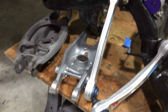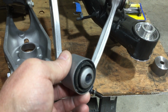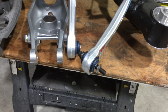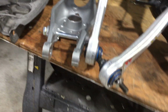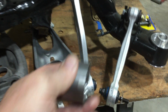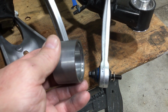And then normally it has a rubber bushing, and I press the bearings in there, and so it has a taper on one side to go to the knuckle. So I had these washers machined up, and now this bearing has to be offset 3 millimeters to work correctly. So I machined up this cup for the press, and if you'll notice here, it's offset 3 millimeters. So now I take this cup, put it in the press, and I press it, and that way it's nice and consistent.